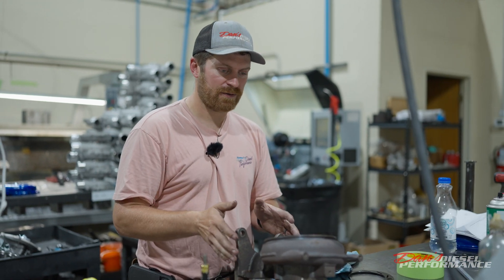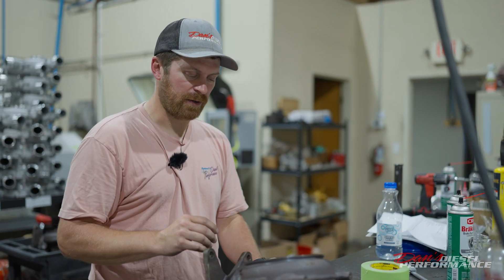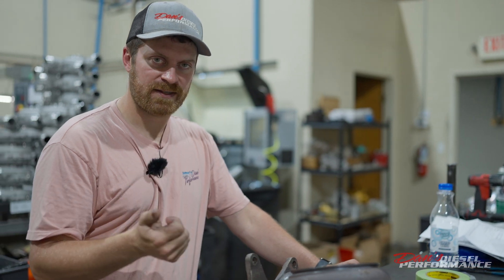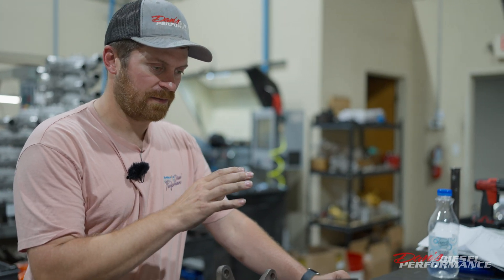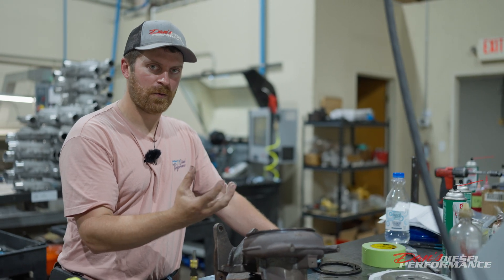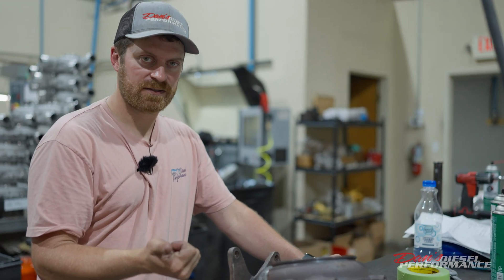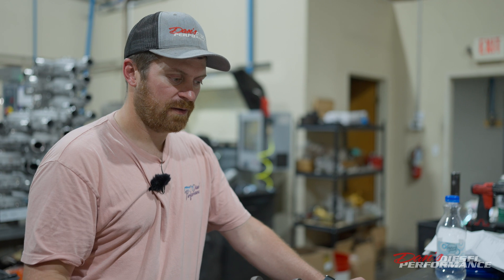When you install one of these turbochargers, regardless of brand, I would run a remote feed line so you're pulling cool engine oil off the driver's side of the block, which also has higher pressure than pulling through the cam bearing. On this LML, you don't have that heat soak of the oil going through the block up to the turbo, so you get better oil flow and cooler oil. If there was a prior turbo failure, replace the air filter — don't just shake it out, get rid of it. Make sure the intake pipe is clean of debris, the mouthpiece O-ring is seated in the groove, and boots and clamps are installed properly and tight. Pressure test the system to 50 pounds with a boost tester. Fire it up, let it idle for a few minutes, then take it out for a drive.